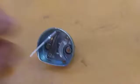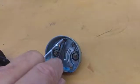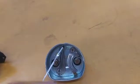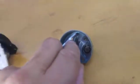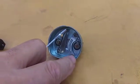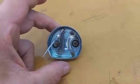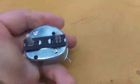That resistance is determined by this wire wound heat strip element here — that's nichrome wire — and as it gets hot it bends the bi-metal, and that's what moves the gauge. The calibration for this takes place up here at the top, not down at the bottom. A lot of guys go to the bottom and adjust that, and that's wrong. You've got to do it from up here and it's a very sensitive adjustment — just a little bit of a turn makes it move a lot. Use caution when you do that adjustment.